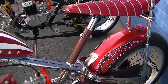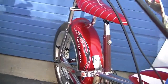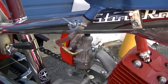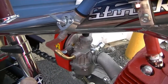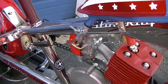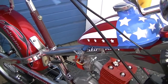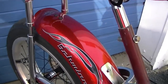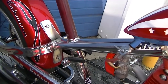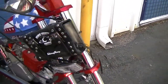When I was building them, the carburetors come with this fuel nipple going straight up, which didn't work for my method of build, so I tweaked them to the side. I was unaware that I'd created a vacuum leak there, so I had to epoxy them in when I had problems with them continuing to run. There are still things I haven't completely finished — for example, the seat post is going to get repainted. Everything will be in perfect condition when it goes out to the buyers.